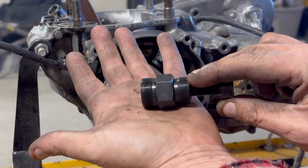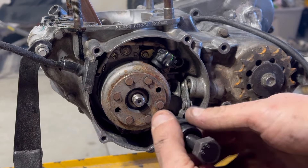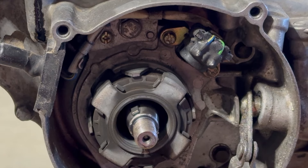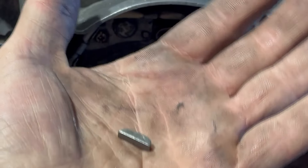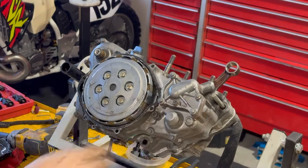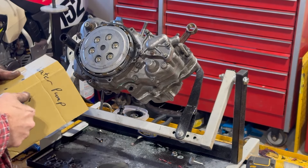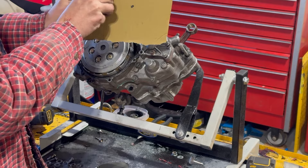So how they work, guys, is that there's threads on the puller itself, and it threads into the flywheel. When you crank this down, it pulls the flywheel off. It's really important not to lose the little keyway — you're going to need that to hold it back together. We'll go ahead and pull the water pump cover off. If you've seen my other videos, we make little templates for our bolts on covers, because those bolts are going to have different lengths and it's important they stay in the proper spot.